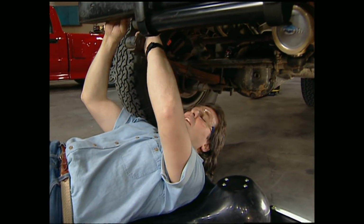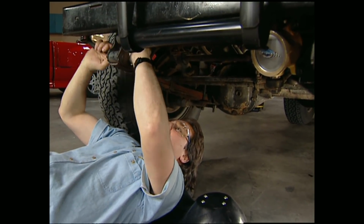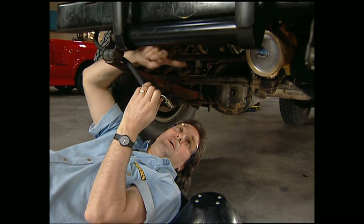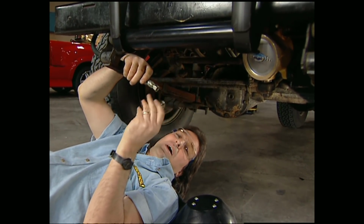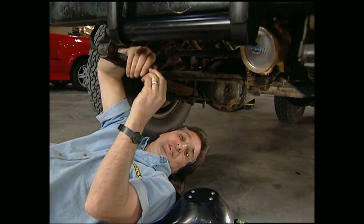Now this winch basically runs in line between the power steering pump and the box. Now we've already made our connection between the pump and the winch, so the last hookup is to go from the winch to the box itself. Now Mile Marker makes a whole bunch of special elbows, so there's no surprises when you hook up to the box.